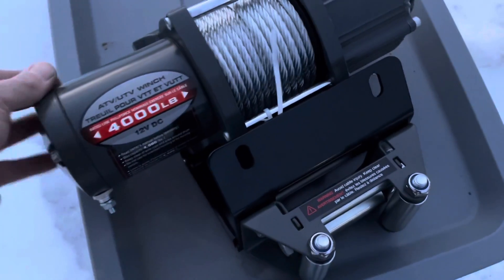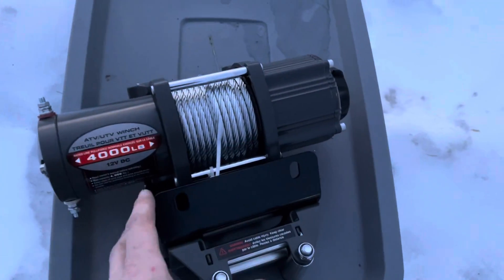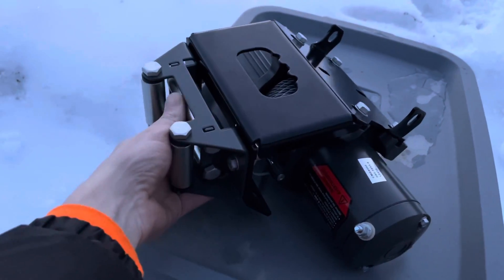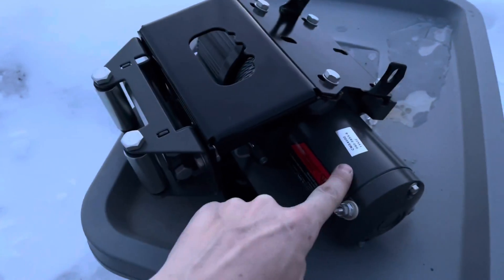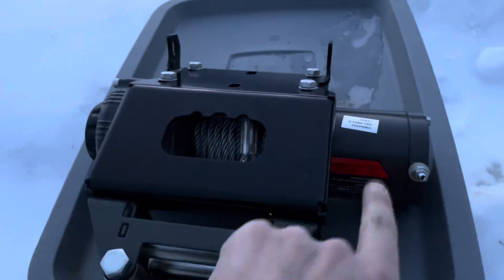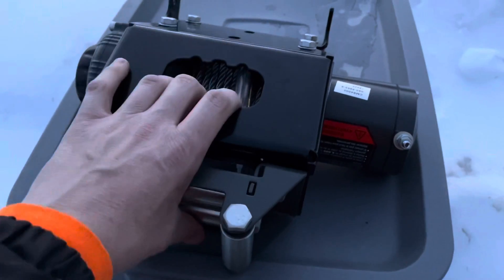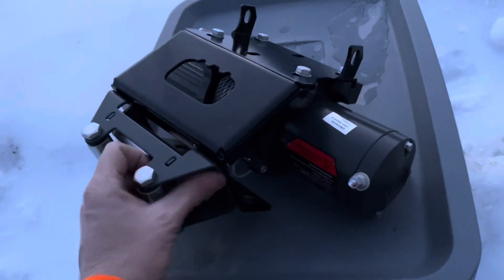It fits 2014 and up, this is a 2023, so I think this is actually upside down. It looks good right there but everything's upside down — believe it or not. So on the four-wheeler it's going to be upside down and inside out. The bolts go down through the fairlead. I pre-attached the fairlead and the winch but I might have to take the winch off again. The motor weighs 19 pounds with the cable, so with the bracket and fairlead you're looking at probably 20–25 pounds. It's a little bit weird how the thing mounts upside down but that's the way it goes.